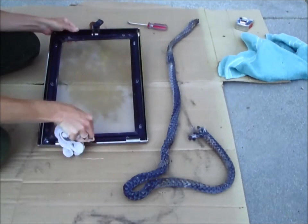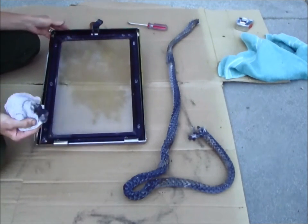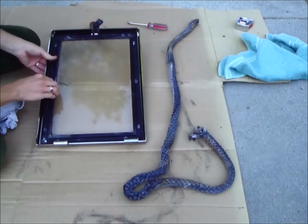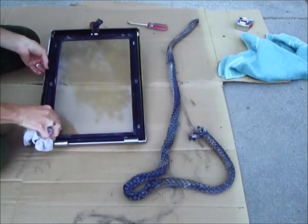At this point, you'll want to inspect the glass gasket. Look to see if the glass gasket is loose, if the glass moves, or if there are any black streaks on the inside of the glass caused by air getting in, and replace the gasket if needed.